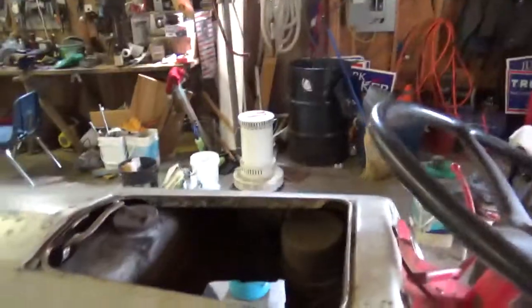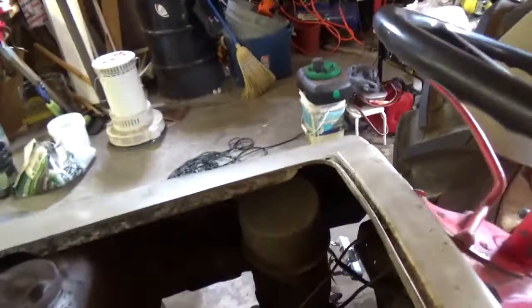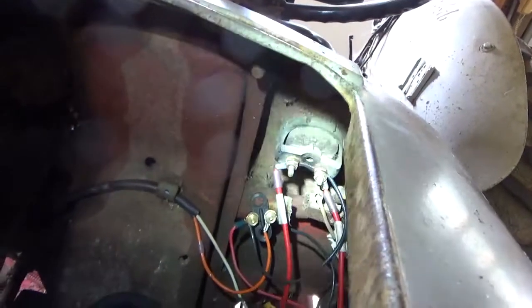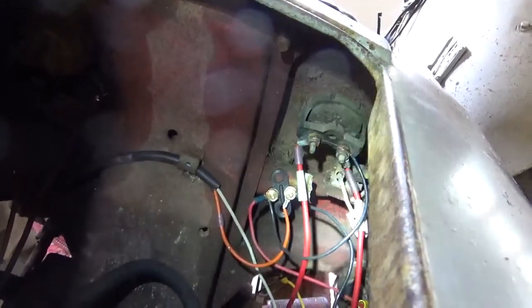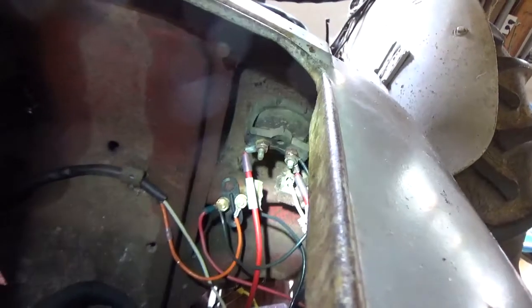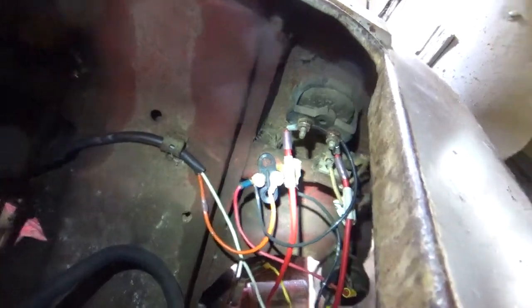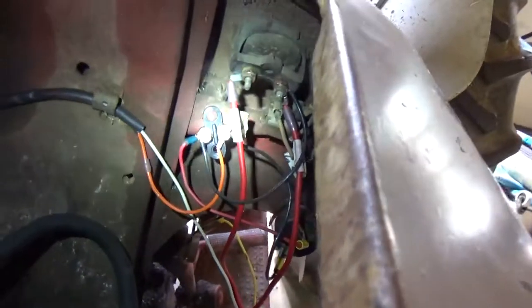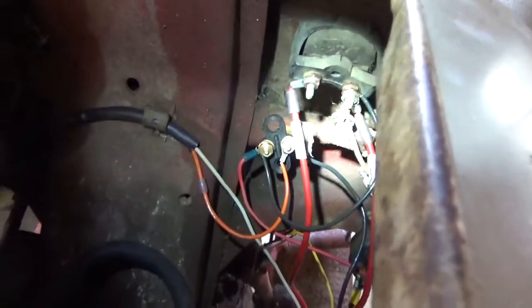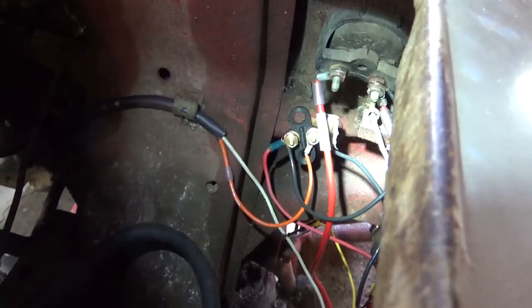I hope this helps you some, because I had a heck of a time finding the information I needed. Just remember: your amp meter is where everything ties in. The two positives — one from your alternator and one from your solenoid switch — hook up there. From there you go down to the terminal block, and from the terminal block you're powering your switch and your coil. The white wire goes into the ceramic resistor, and the orange wire comes back to the terminal block providing power to your coil. Hope this helps — have a good day!